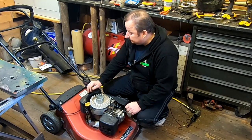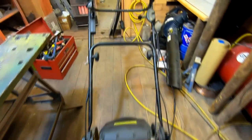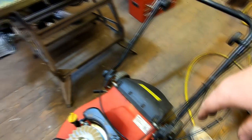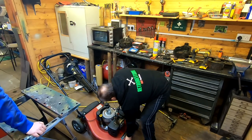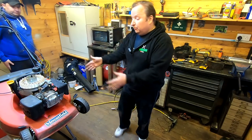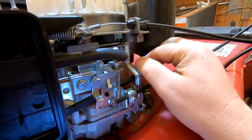We tried to mess about with the pull cord and didn't succeed, so we came up with another alternative - using a higher power drill - and you've just seen it run absolutely perfectly. That initial pull you get with a pull cord should be enough to kick start it, but we can't test that until we get the correct spring. A little lesson: if you're not having any joy starting it on the battery drill, it could be that you're just not turning it over fast enough. The mower is now ready for a refurbishment - we can order the spring and start the restoration. It's got a four-speed drive, cables are all in very good condition, there's a grass bag for it - this should be a good earner. Gary paid £15 for it.